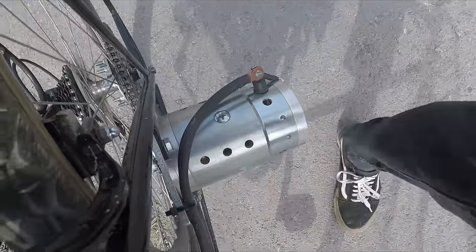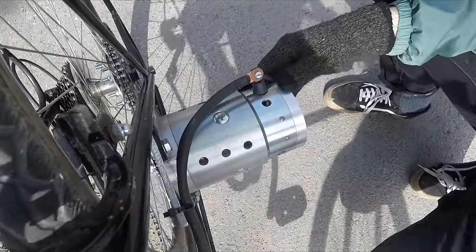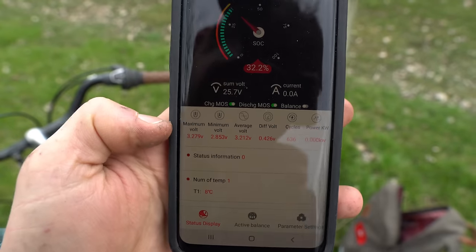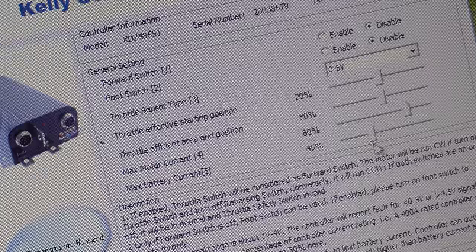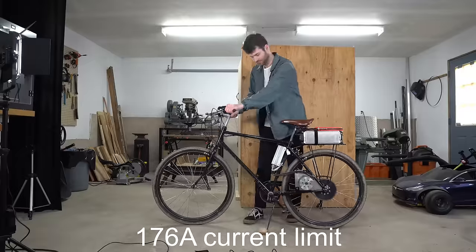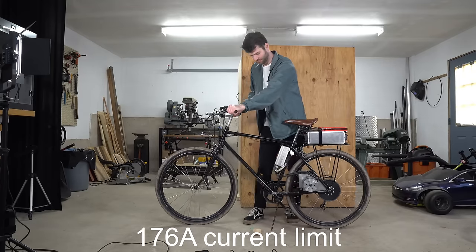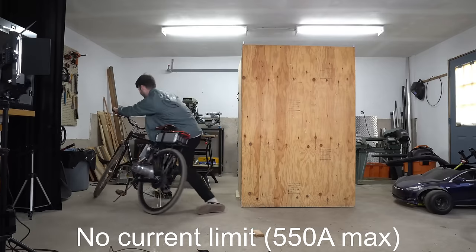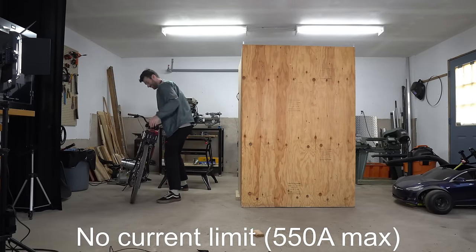In conclusion, it's safe to say that a starter motor is not an ideal choice for an electric bike motor. Even with the cooling holes, the motor eventually ended up overheating. The starter motor is also inefficient and drains batteries very quickly. If I limit the battery current to anything less than 200 amps, I can hold the bike stationary while keeping it at full throttle, meaning the motor has to draw a significant amount of current just to get the bike moving. I don't have a current meter on the bike, but I'm assuming it was drawing quite a lot continuously during each test.